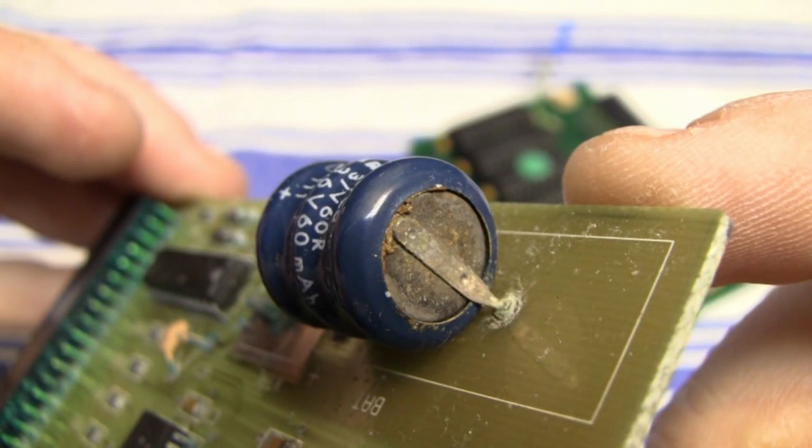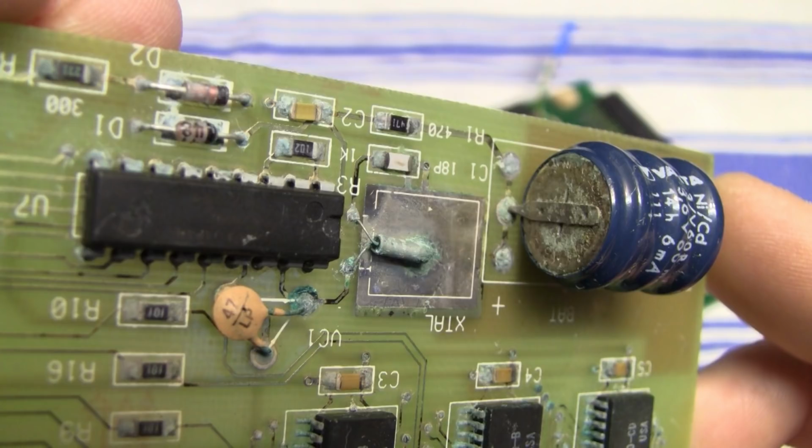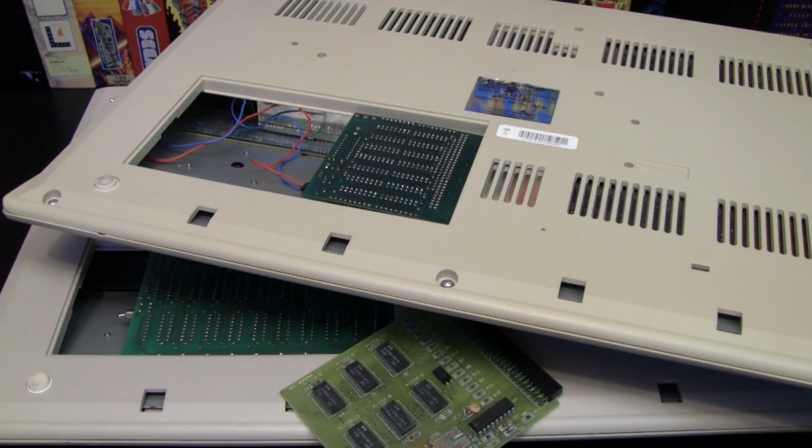And the same thing goes also for every Amiga 500 Plus owner. The only difference is that in those machines the battery is actually on the motherboard, which can be an even bigger problem, since if those batteries leak they can destroy the entire computer. So again, if you have an Amiga 500 with a 512 slow RAM upgrade or an Amiga 500 Plus and the battery is still in there, remove it and clean the area thoroughly.